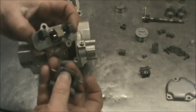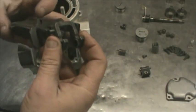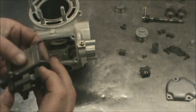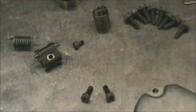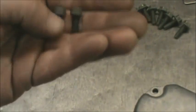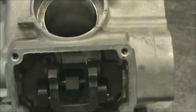Once you get this far, take this arm with these facing forward and slide them into here, just like that. Then go ahead and slide the whole valve assembly right down the throat of the cylinder. Under the mass of bolts on the bench, the plate with the two holes — there are only two allen heads, 5x8 threads — that's what we use to retain that plate. I like to use a little bit of blue Loctite on these, just get those two bolts seated in there.